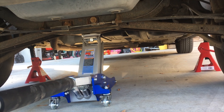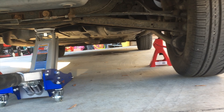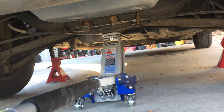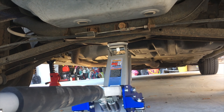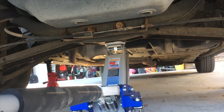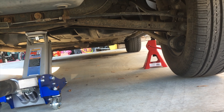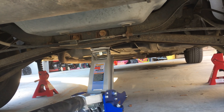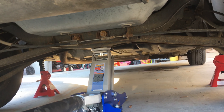Because these cars have the welded seams for the body and you jack them up where those seams come together into the sides, you don't have room to put a jack there and then put in a jack stand to hold the car up. So right where the rear end comes together, you can see there are two portals for the tow chains to go through. You can jack it up right there, then put your jack stands underneath the seams so you can get to the solenoid and the charcoal filter.